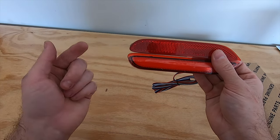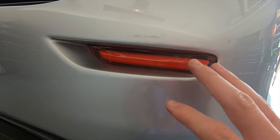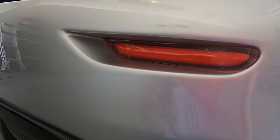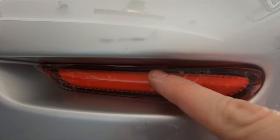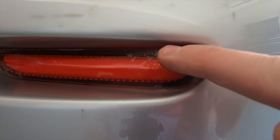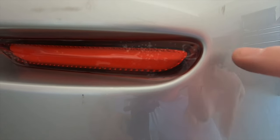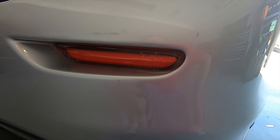Here is the passenger side one already temporarily put in the car. It's all the way down as far as it'll go into the seam, which is nice, but as it moves outward the gap between the top and the body decreases significantly to a point where it's actually pushing against the body of the car on the top, bottom, and corner of the bumper. If I trim some of that out, this would slide in a little further and help close up that small gap on the outside. I'm gonna go ahead and knock that out on both lights.